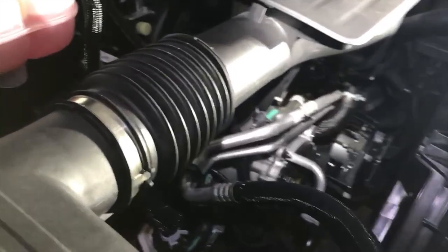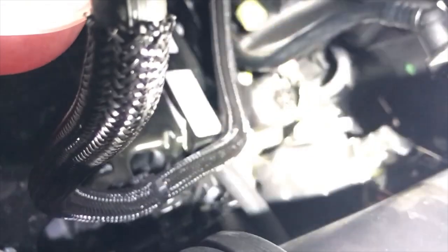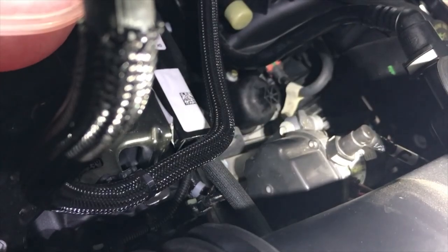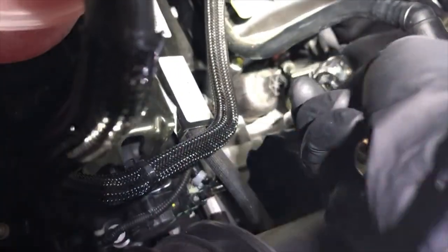A stool or chair also helps. Since it is off-road, it added a little bit of lift. Now to reach the oil filter, which is tucked away there. Again it is a 15/16 inch socket — hex head, or I believe a 24mm. Put it on here.